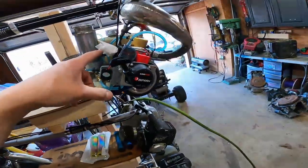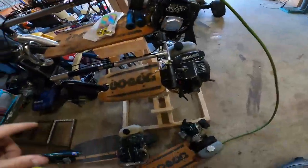Well, if I shut the high side, it idles just fine, but as soon as I open the high and try to set it where I want it, it floods the engine and kills it, so that check valve is hanging open. And that's probably because of the diesel fuel I put through that carburetor, which, yeah, was stupid, but for science purposes, right? I got to order a new carb for this, so that's coming in.